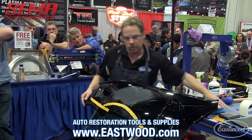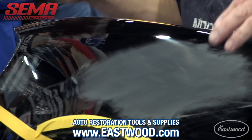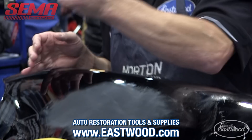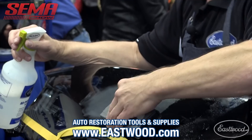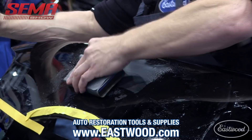Now we're sanded with 2,000 grit. Do you see the difference in the color? It's lighter here and darker around those edges — a little bit of difference in color and texture. Because I've run into this before, I need to sand a little bit more on the outside edge. It's very important to finish step one before you move to step two. The guide coat is nice, but you've got to use your eyes and read what the panel is telling you.